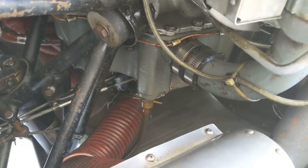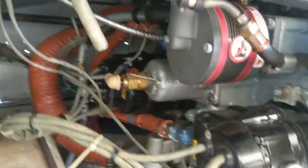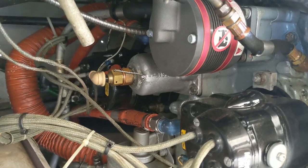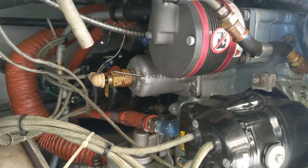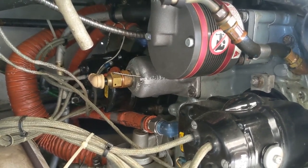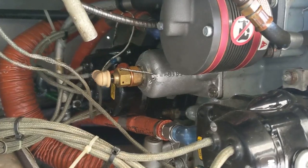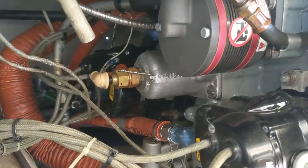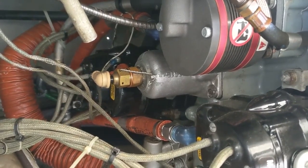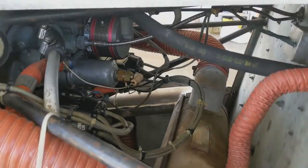While waiting for the oil to drain, I need to come over here to this thing with the little plug on the end — that's my oil pressure screen. It contains a little screening element and a gasket, and I have to take it off, clean out the screen, and inspect it for any large pieces of metal, then replace it and put it back. After annual I'm anticipating putting on an adapter that will allow me to have a spin-on oil filter, which will do a much better job of filtering and will let me go from changing oil every 25 hours of flight to every 50 hours.